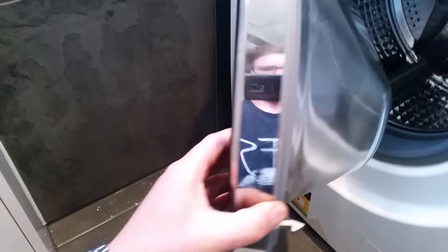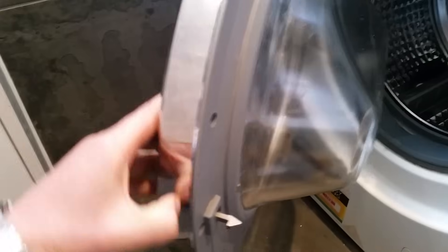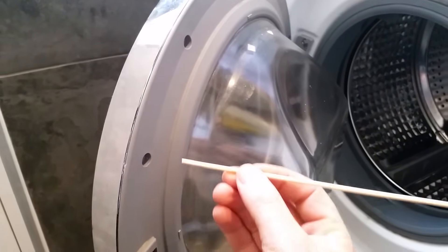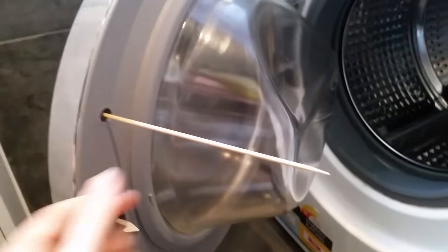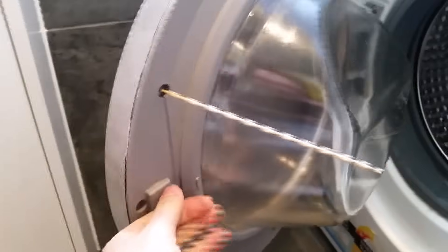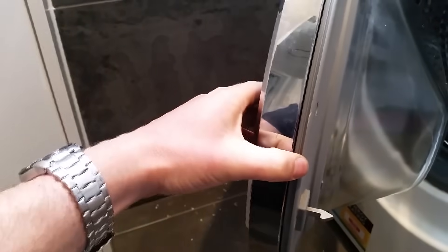So to take this, we'll take this silver part off away from this gray part. I found it quite difficult the first time — can't really get in there. So what I ended up doing was taking a wooden skewer, just the chicken skewer type, and pushing it through one of the screw holes and holding on to this part, pushing gently a few times through a few different holes. That came off fairly easily — just through one hole and the whole piece comes off.